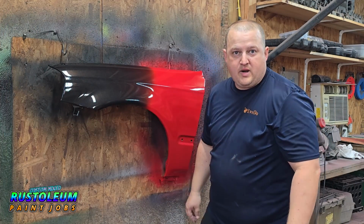Alright guys, so here's the spray out today. A Graphite Pearl over Gloss Apple Red and Gloss Black. Now, for the subscribers that wanted to see the Graphite Black Pearl over top of the red, what did you think of it? What I tried to do is not overload the mix too much because I was worried about the salt and pepper effect where you put a dark pearl or flake over a light color and it looks dirty. And I actually think it turned out pretty good.